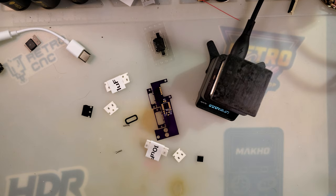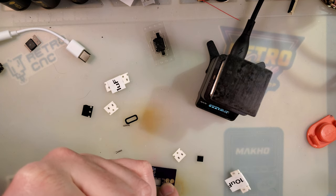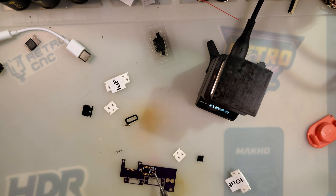One of the things that I don't really like about this kit, but there's not much that can be done about it because of how Nintendo decided to do things. This specific kit uses USB PD 12 volt, which, my solder paste is giving me trouble. I'm gonna make a mess, aren't I? Oh, it's dried out. That can't be good. One of the things I don't like about USB PD 12 volt is that 12 volts is not supported on a lot of power supplies. So if you have a 12 volt supported power supply, then you're better off than most, but this means something like a Nintendo Switch power supply will not work for this mod, which is a little unfortunate, but it is what it is.